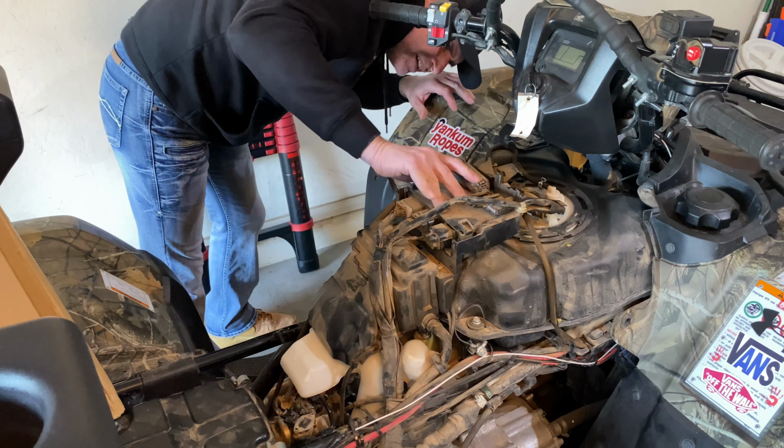So I'm gonna cut this video, guys. We'll be back. But that part number I gave you guys, which is 16700 HR3 A21, is not right for the Honda Foreman. Now, this isn't the Foreman Rubicon. This is just a Honda Foreman. I'm warning you, this one is for the Honda Rubicon Foreman.